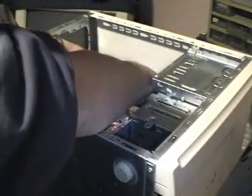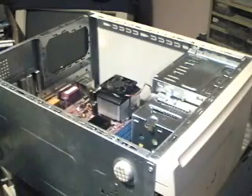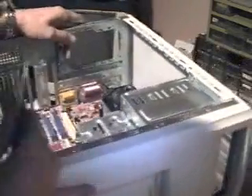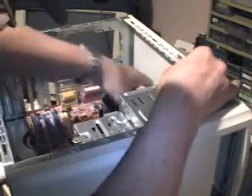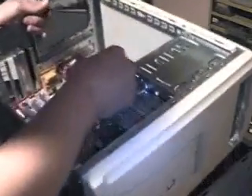You'll notice the front and the back. What we'll do here is use the little flat-head screwdriver, push it down and get it clipped on. You want to make sure that it gets all the way clipped on. Now we've got our heat sink on. This little guy here plugs in — they're all different on every motherboard, but we'll find a spot for the fan. They're pretty self-explanatory on how they plug in.